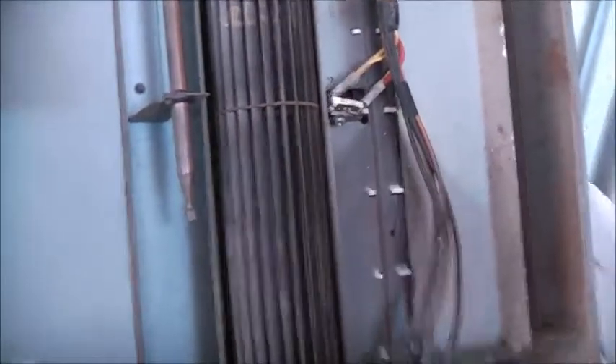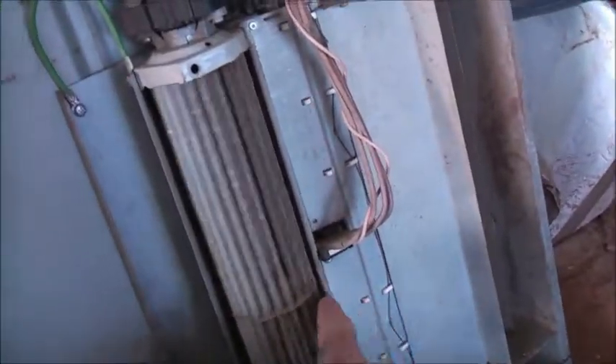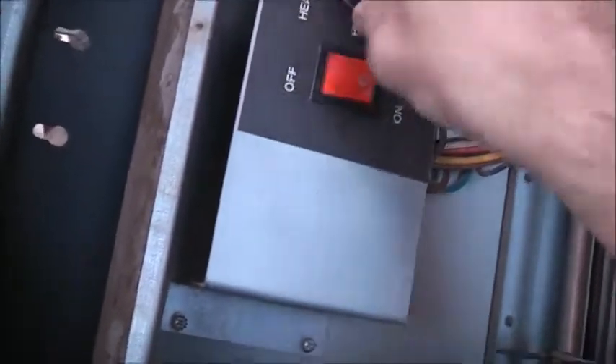That's mechanical damage - it's a thermostat. So if this seizes up, that will trip out and shut the heater off. This is a Bourdon tube type thermostat in this heater. No bimetallic strip for this circuit in here. This is useful, I'll keep that and the switch.